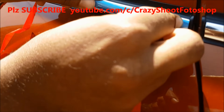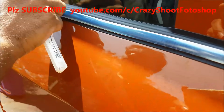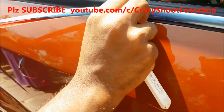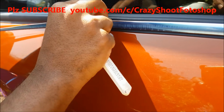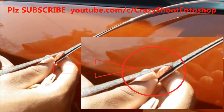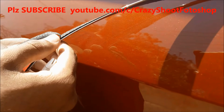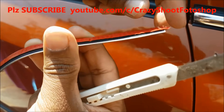Sometimes you can find that the double-sided tape cannot be properly peeled. I'm sticking here — the first stick was fine, I slowly started sticking, I'm removing the double-sided tape, and now you can find that I also got the gum along with it. In this case, you can just cut off the chrome beading for a few inches and start fitting the chrome window trim again. Now the strip is okay and I've continued pasting it to the window trim.